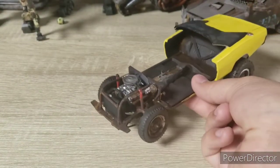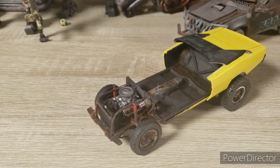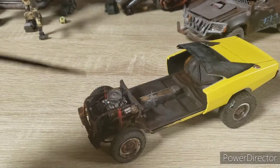So you had to build these braces, and that's what they did for NASCARs. How did I learn that? From the man Mike Finnegan. Mike Finnegan bought a '68 Charger that was built for NASCAR but never made it to the track. And the guy cut out the inner fenders, and he didn't put any kind of bracing there. So when they were jacking the car up, they were bending the front end in half because there was nothing there. So yeah, if you have a '68 or '70 Charger, don't do that unless you roll cage the car. That is what I based that off of.